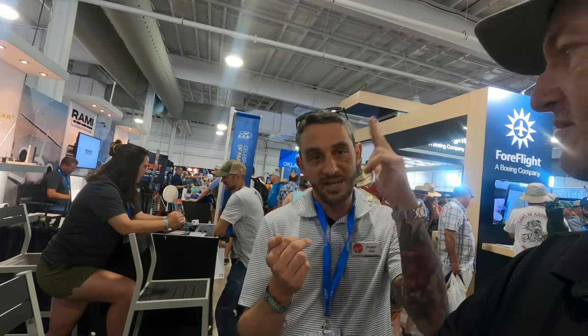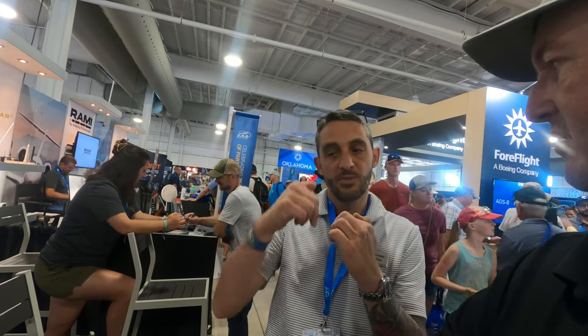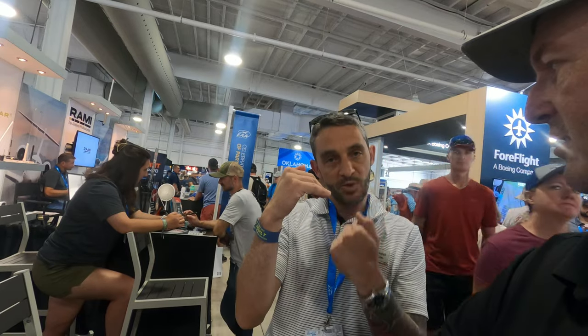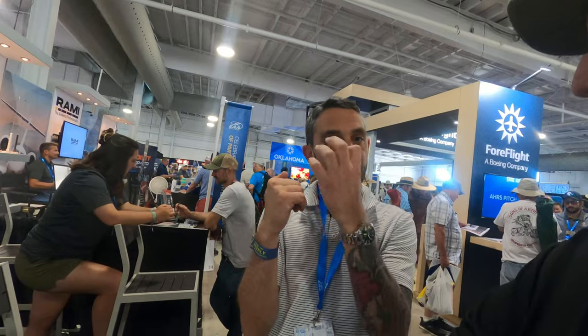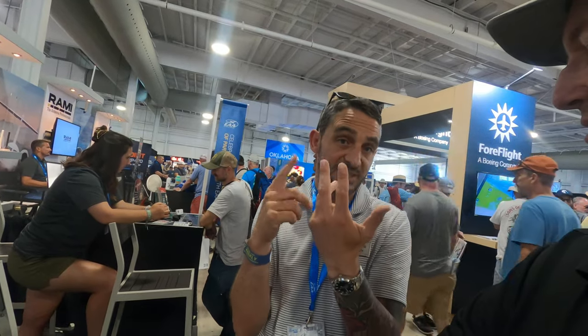So how many times are you going to use your aircraft? How many times are you going to drain the tanks? Because each time you drain the tank, that's when your resistive sender starts to fail. Each time it goes down, the fuel is coming out of the resistive sender, but the additives are staying behind. And those additives build up, and they end up sticking your sender.